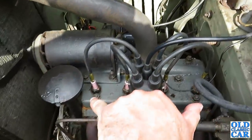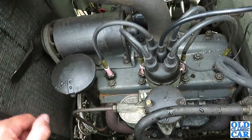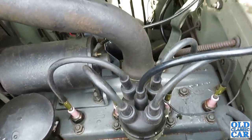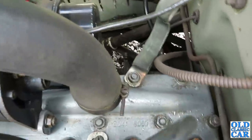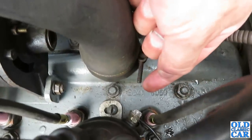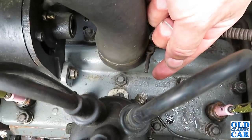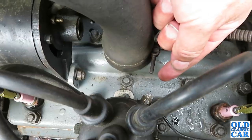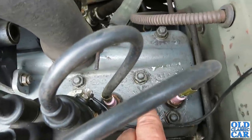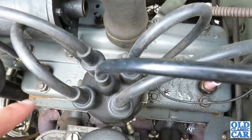And you can see the cylinder head itself is tiny really, so if push comes to shove that can always come off. You can see that it is stamped, if we can just look here, E04A. That was the model code for the pre-war Anglia, the E04A Anglia, and that shows, as does the Y, that this is an 8 horse head.